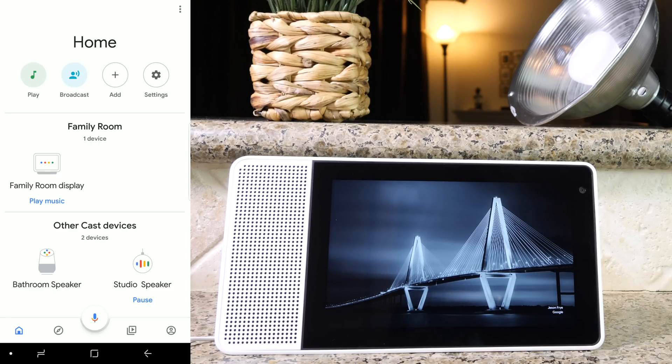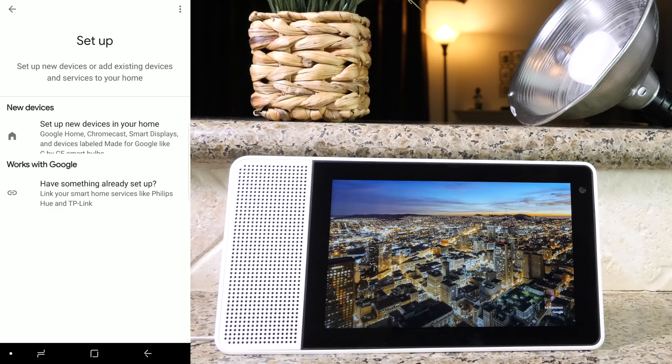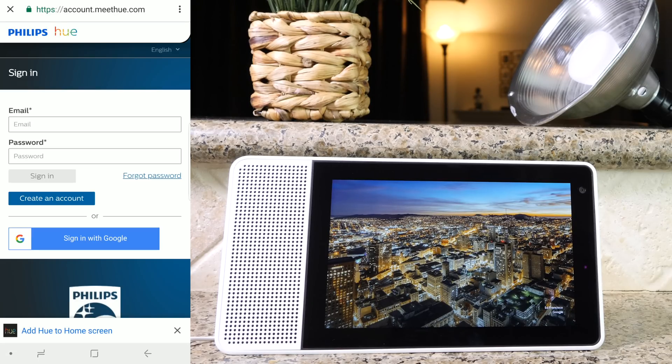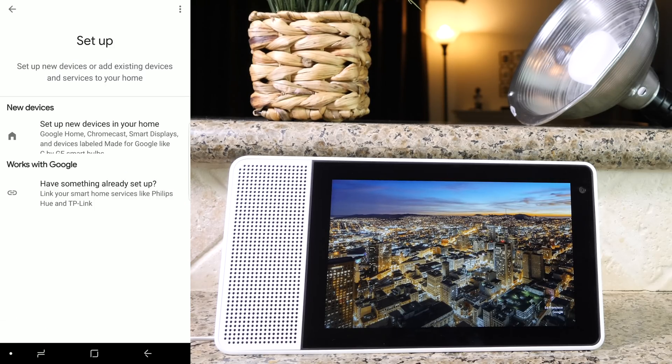All Google products will support smart devices like Nest thermostats, plugs, and all kinds of things. Now I'm going to show you how to set it up with the Philips Hue system. To add any kind of smart device, from the home screen go ahead and press Add. Next, press on Set Up a Device. At the bottom, go ahead and click on Works with Google. Since I'm setting up the Philips Hue system, I'm going to go ahead and type in Philips and press on it. It'll take you to the Philips Hue website — sign in with the credentials you made when you originally set up your lighting system. If you're logged in successfully, you'll need to grant permission to Google.